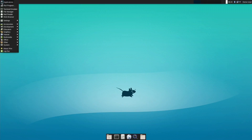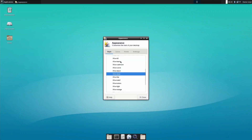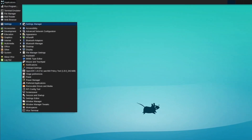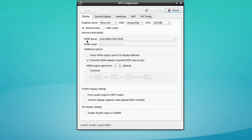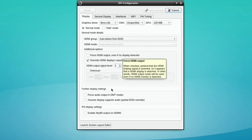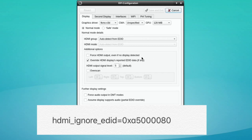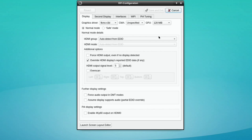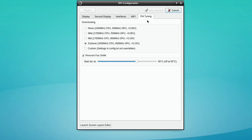Let's look at settings — there are loads of options. I've messed about with appearance a little bit and applied the 'dusk' theme. Going back to the top, there's advanced network configuration, appearance, Bluetooth adapters — so much in the settings. There's also a Raspberry Pi config tool which appears on first boot, with tuning options. Mine defaulted to 4K, so I forced 1080p in config.txt for screen capture. There are interfaces, Wi-Fi, and overclocking settings in there too.